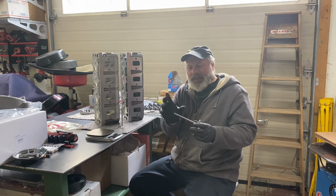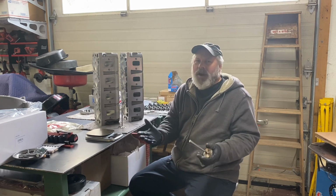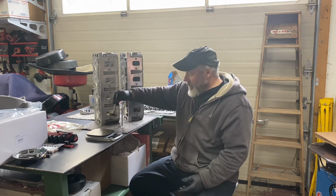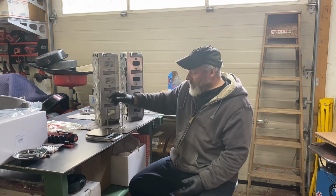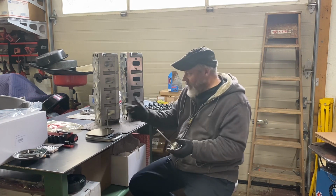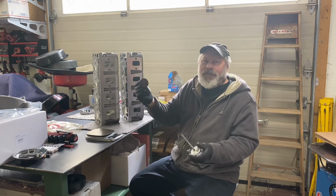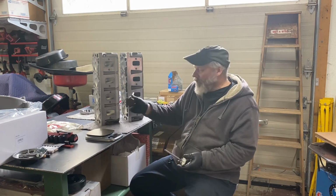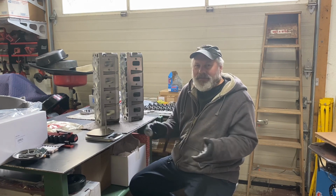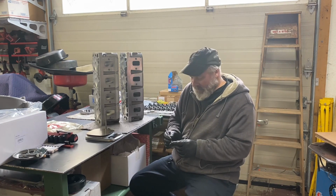I would have to have crazy spacers, and the rocker arm geometry is all wrong in this imported head. So those weren't going to work. So I bought a set of stainless valves because my budget and need for titanium isn't there. This isn't going to be a super high RPM engine. I mean, we're going to cap it at 7,000 maybe.